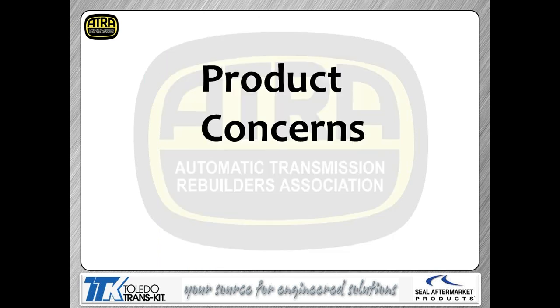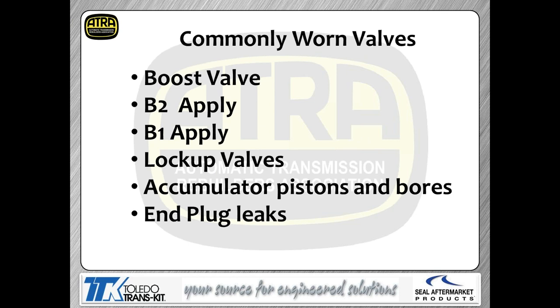Now, as I told you when we first started, we're going to spend a lot of our time on product issues today. So let's jump into some of the product concerns we're going to see. The most commonly worn valves in this transmission are these guys right here. Your boost valve, your B2 valve, your B1 valve, all the lockup valve train, the accumulator pistons and bores, and the end plugs. Now, one thing I did not put in here, I should have, is the pressure regulator valve train. You got a couple pressure regulator valves. Very common that those valves physically wear out.